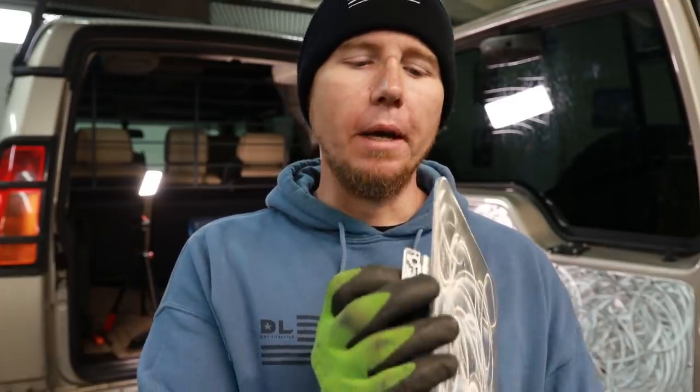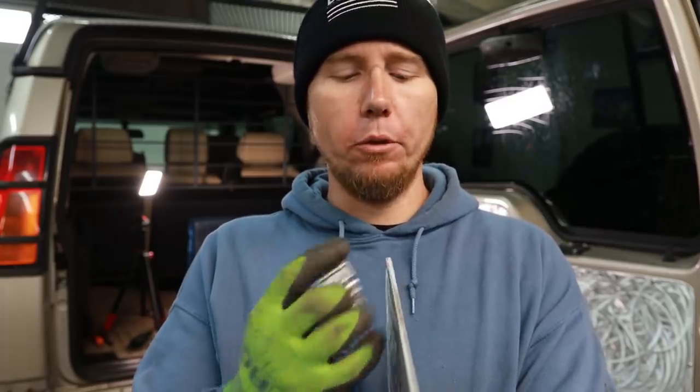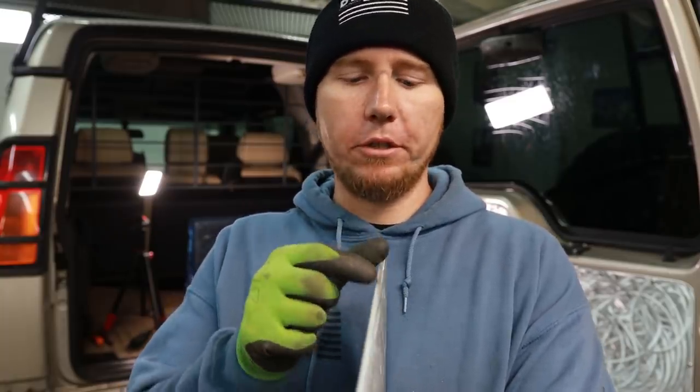I'll be using these hinges in a manner that they're not really made for — they are made to do this, but these aren't designed to be offset 3/16ths of an inch. What I'm going to do is cut some little spacers that match the same thickness and width, and tack weld them with my TIG torch onto this base plate. If you are following along and you need to stick aluminum together, you don't need a TIG torch. I actually have a video in the description that shows you how to stick aluminum together with a rod called Lumiloy — it works better than you'd think, and for this kind of application I'd say it's perfect. But since I own a TIG torch, I'm definitely going to take advantage.